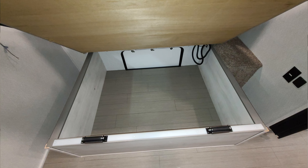You have two good-size storage compartments on this side — the doors flip down. There's also a six-gallon gas and electric water heater. Flipping the door open, you can see the one-and-a-sixteenth-inch drain plug in the bottom, the electric switch to turn it on in the lower left corner, and the pressure relief valve in the top center. Make sure you relieve the pressure before you try to drain it. Down below you have your onboard propane tank, which you'll have to drive somewhere to fill. Just above that you have an electric outlet and a cable outlet — so you could plug in a TV out here under your awning — and your furnace exhaust is out here as well.